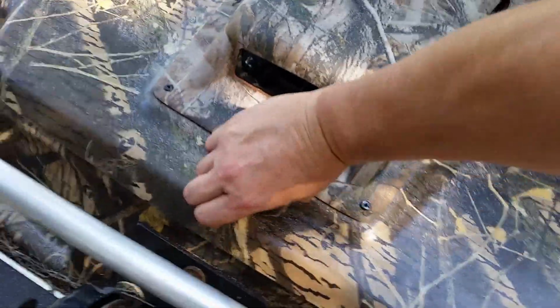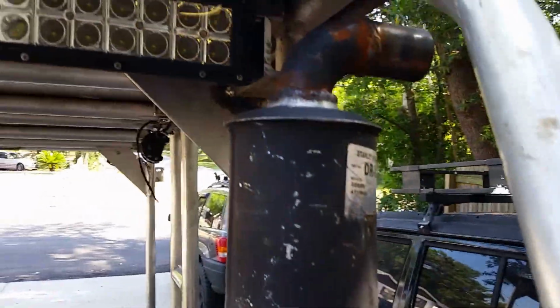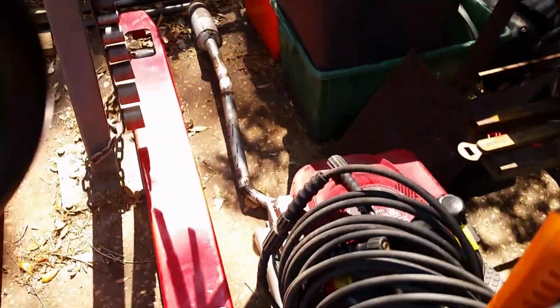Some of the other things that I've done, we have a new heavy duty clutch, front and rear. I put that in. There you can see some of the axles and the chains. It's got all new chains, all new bearings, all new hubs. I made a custom exhaust. Comes out, made a custom flange. Flange comes out to the exhaust. Had another one on here, but it was too loud. I mean, this thing sounded like a dual V-twin. It was loud.